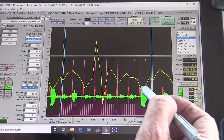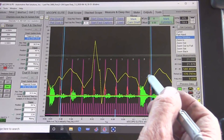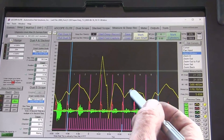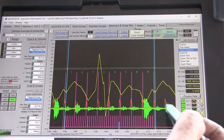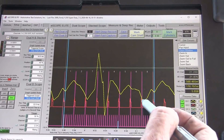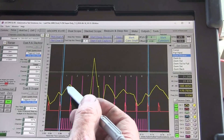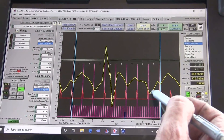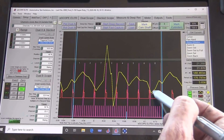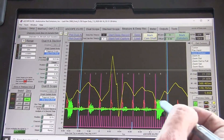The crank actually slowed down more than it should have, and then over here it started to rise. Do you see how this cylinder fired close to top dead center and accelerated? Do you see how that didn't happen over here? Do you see how the crank didn't fire right away? See how this one sped up right away? Do you see how the crank slowed down and then it went? That's because that injector is leaking fuel into the cylinder. And when it leaks fuel into the cylinder, it knocks.